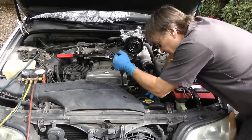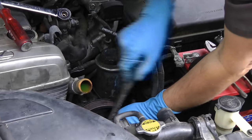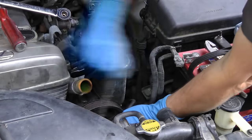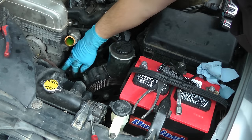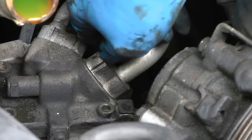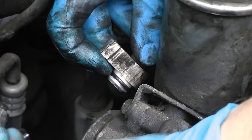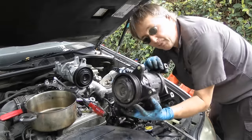The next thing you have to do is pry on the fan belt tensioner and pull the fan belt off. Now in this case the power steering pump is in the way, so we're going to take it off too. With the pump moved out of the way, we can get to the bolts to unbolt the compressor. Then you remove the refrigerant lines on top of the compressor by unscrewing the bolts and then pulling the lines off. Now to make sure nothing gets in the line, get a little piece of paper towel, wad it up and stick it in the end to block it. And the compressor just pulls right out.